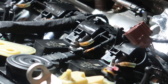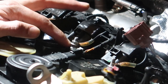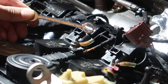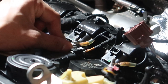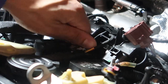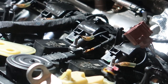You may be wondering why people do this. The main reason is this top nut sometimes is too tight — when you go to loosen it, it tries to spin the whole thing and you may wind up snapping the ground off. I went out and bought a very thin 10mm that sits under here to hold it so you can loosen the top nut. Over time these bottom ones here — they're not a complete circle, they're ovaled to help stay in — they'll eventually strip that spot.